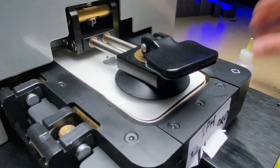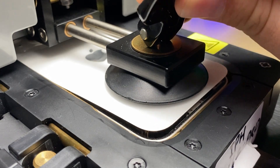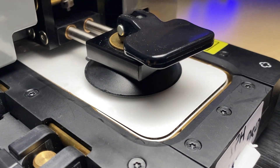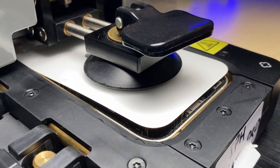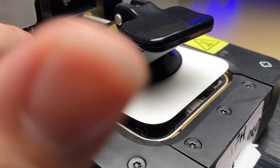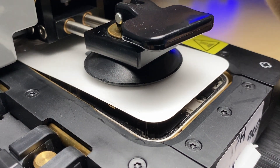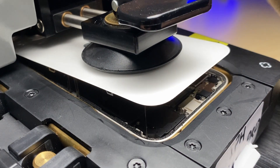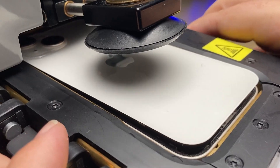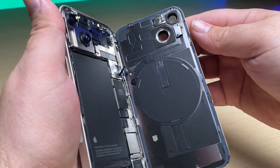I'm going to release the suction here, just slide this back a little bit, lower it down again, engage the suction, and lift it up so there's less tension, less flexing of the glass. Now, you might be wondering how to use this suction if the back is really broken — you can always install tempered glass on the back, or do packaging tape. Anything that you can do to create a flat surface will definitely help in removing the back. And there we go — pull it out of the mold, and get the top to release so that it can fold out like that.